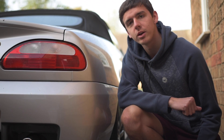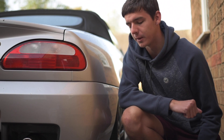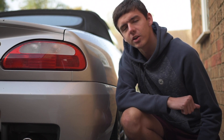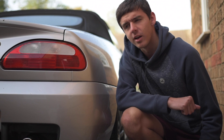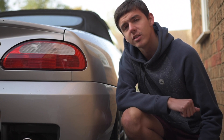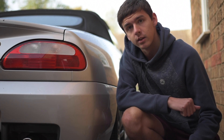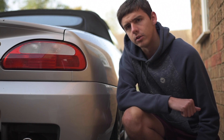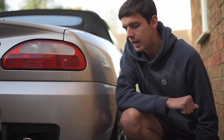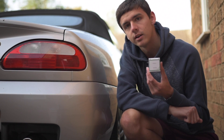Welcome back to Cars with Willow. Today is a video I wasn't planning on making, but I was driving home from work the other day and all of a sudden I couldn't select any gears at all. I had to pull over, faff about for a bit, turn the ignition off, and only then could I put it into second gear and nurse it home. Today I'm going to show you how to take the inspection cover off so we can look at the engine fully, and hopefully it'll be a simple fix with the slave cylinder.